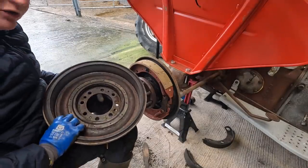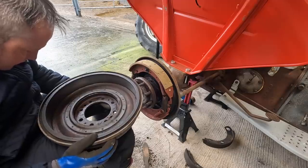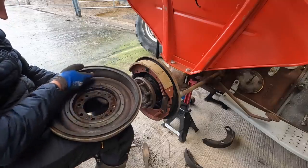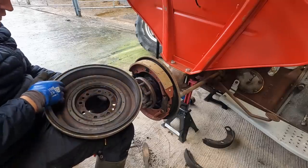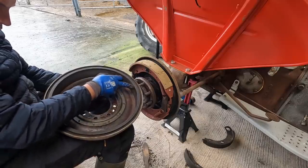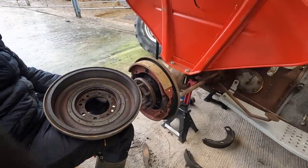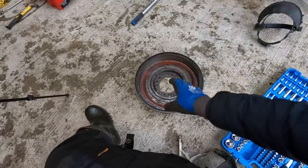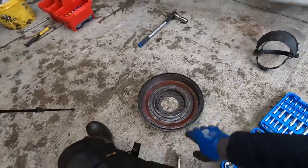Just before you put it back on, check the inside of your hub to make sure everything's all right. This one here is pretty clean - I don't see any reason to have to do anything with that. I might run a bit of brake cleaner on it and use some Scotch-Brite to clean it up. I ran it with brake cleaner, then came along with the power washer and put a degreaser on it. It's an awful lot cleaner than it was. I'm just going to run around now with the blowtorch to dry off the surface inside, then we're going to put it back on.